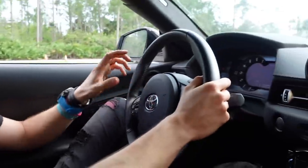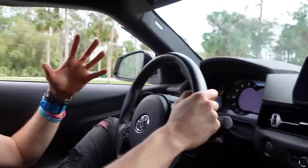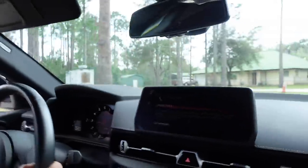So it's really far from what it's going to be, but we've got the torque management working on some of the gears. It's still a little too violent, so we're going to dial it in. But you can feel it's actually taking the torque out on the upshifts. On the downshift it's doing the blips, so that's exactly what we want. There's still more refinement that needs to happen to have it not overcut or overblip, and have the ECU happy with all of the tractive torque values. But anyways, it works. As soon as we have this done, we'll be ready to do some clutch kicks and stuff.